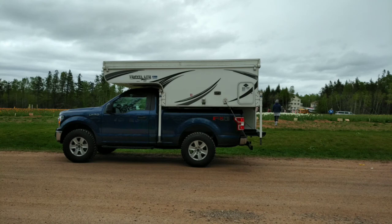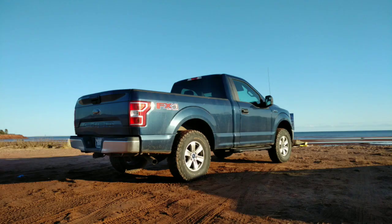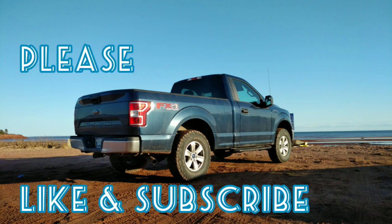In review, you need to know first the axle rating — what that max rating is for the assembly from lug nut to lug nut. Then you need to know the wheel ratings bolting onto it, and then the tire ratings on top of those wheels, and how they're affected whether it's a steering axle or a load axle. Remember, GVWR is a recommendation, but once you know your true axle ratings, never exceed them — front or rear. If you found this helpful, please like and subscribe.